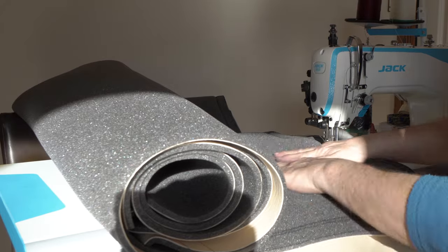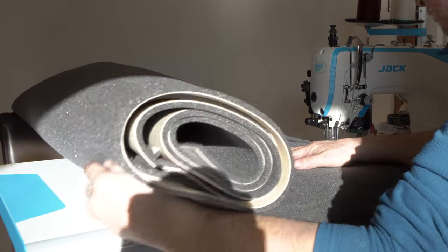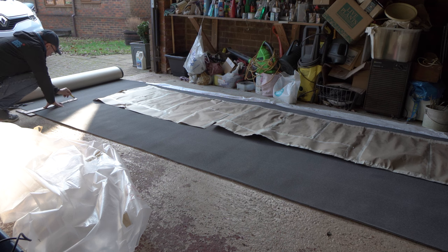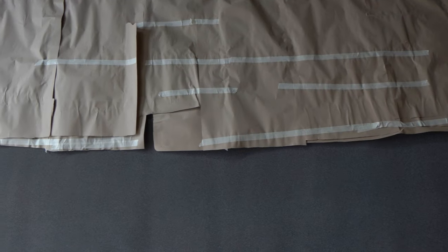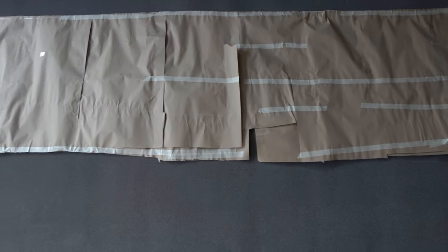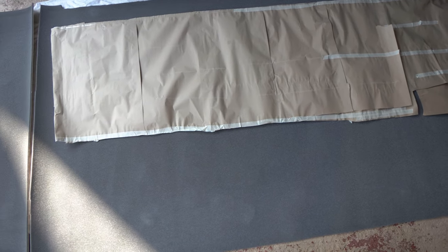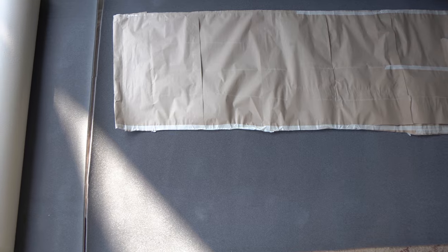At this point I'm hoping I got my templates right. For the main cabin coach roof panel I cut the headlining to the overall size and will make more detailed cuts once in place. A mistake I made a couple of times was not having the template foam side up, which cost me four metres of material — though it's all useful for making trims or smaller sections.